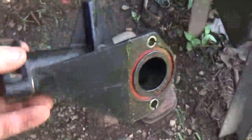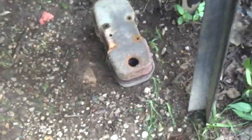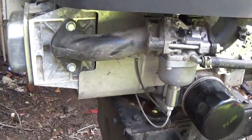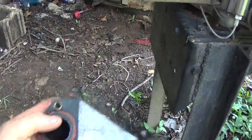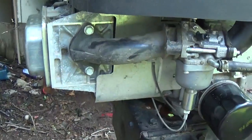YouTube, if there are any questions as to something I didn't potentially cover, please let me know. I would like to add that the intake manifolds are a really good spot to start if you have an engine that's been running hot and you're curious as to why — it's generally because of an air leak, and that's generally because of the little seals or gaskets that go on the intake, which as you can see this one is typically red, and it would be right here. Until next time, YouTube.